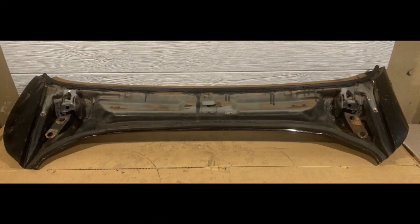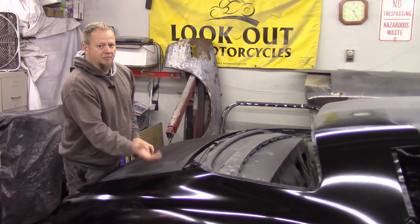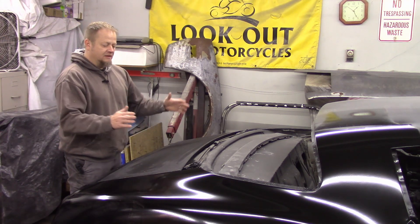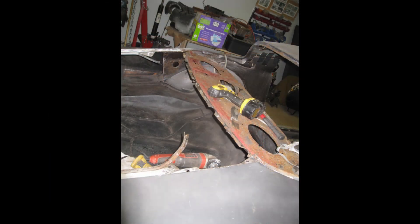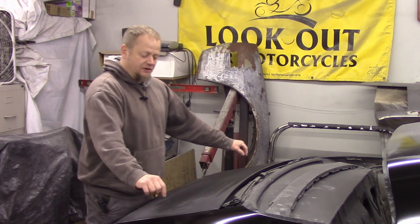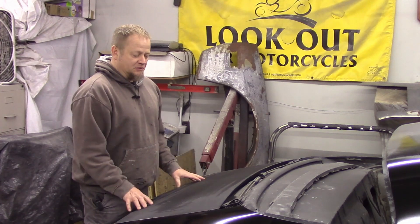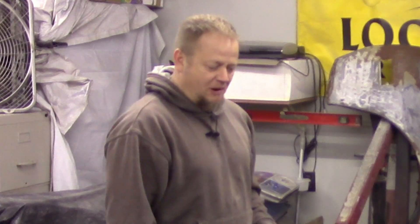It had a little extra metal, so this piece is actually sandwiched in between two other pieces of metal — it's below the lip of the quarter panel and above a support in your trunk. I worked out the spot welds, got everything loosened up, and surgically removed it just the way it was installed. Before I did that I took a bunch of measurements side to side and in an X pattern, wrote it all down. Once it was out, I primed up the piece, fitted it, spot welded where needed, got my channels lined up again, and went on with it.